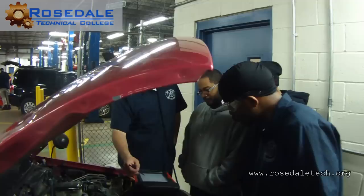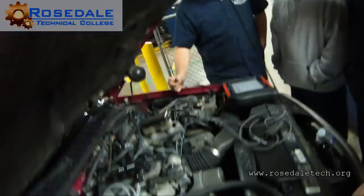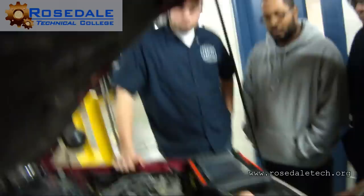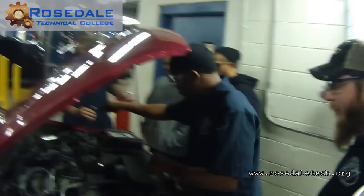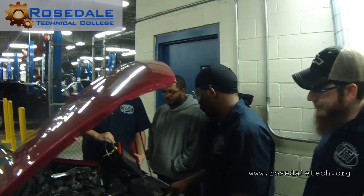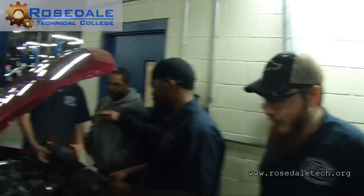Yes. All right, now listen. The way this tool is right now, we'll be able to see all the cylinders firing. The problem is we won't know what's what. That's what this is for. That goes to my number one spark plug, which is over there, and that goes to the auxiliary port on top of the tool. A little bit tricky to plug it in. I'm going to need a firing order for this vehicle, too. Pull that up. Grab me a firing order, I'll come back.